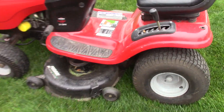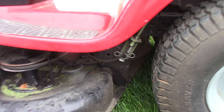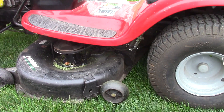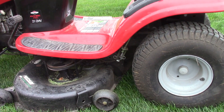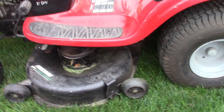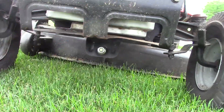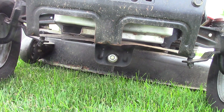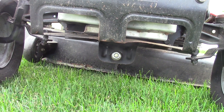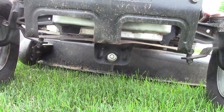On the right side of the machine down here by the deck, there's one adjustment nut that adjusts both sides of the deck. The problem is the deck is too low and doesn't cut even because it only supports the left side of the deck. There's also a nut on the front down under the muffler — you can adjust that to lower the front pitch of the deck. You want to keep the front pitch about an eighth to a quarter inch lower than the back of the deck to get a nice cut.